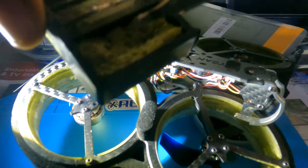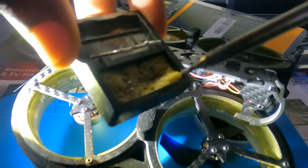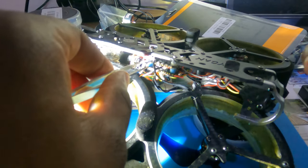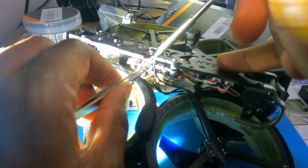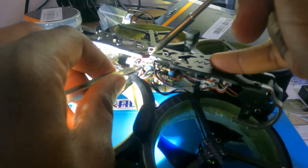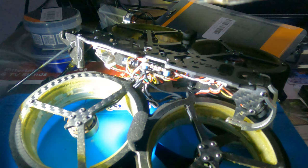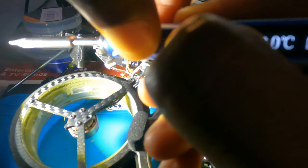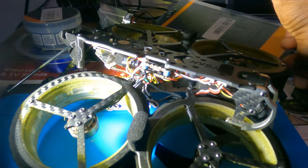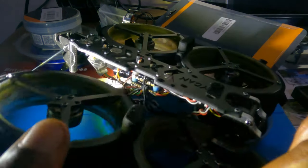Like when these melt just like butter. Most important to take the opportunity to clean your soldering tip periodically. Folks will have various conflicting methods of doing it. For me, a damp sponge works great. That is that. And let's pull the last one. All right, great. I'll switch the soldering iron off. Park that safely. Don't burn ourselves up.